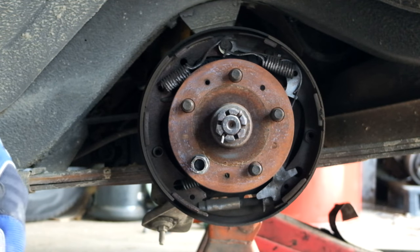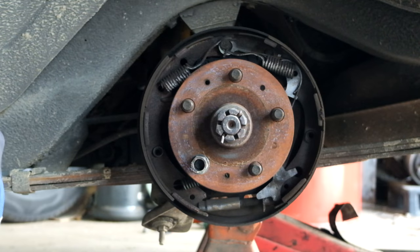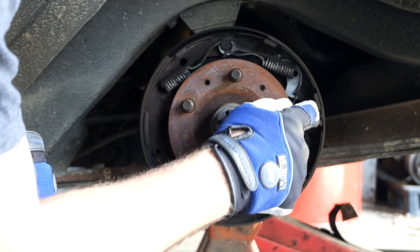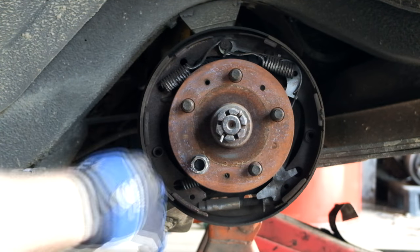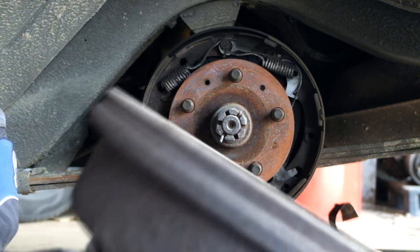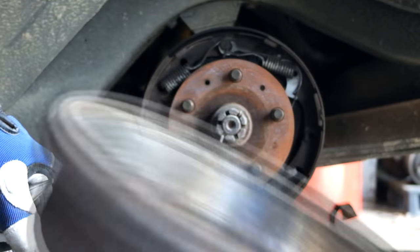You get to look at a beautiful brake drum, and a lot of people are very confused by these. I have used every bit of the shoe on this side — it's less than an eighth of an inch thick, which is kind of ridiculous. This side is still pretty good. It's like it's just riding on the back part of the shoe.